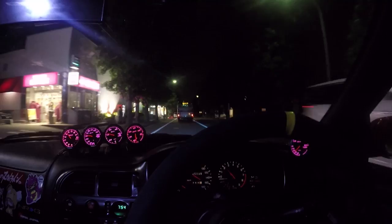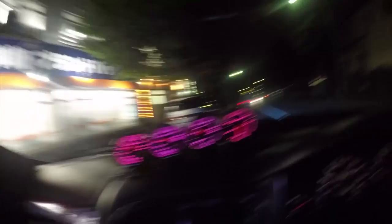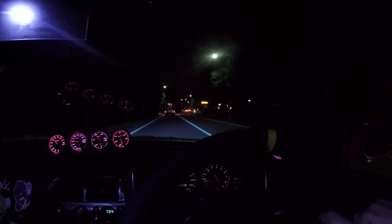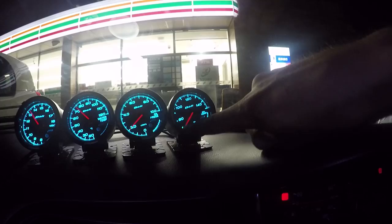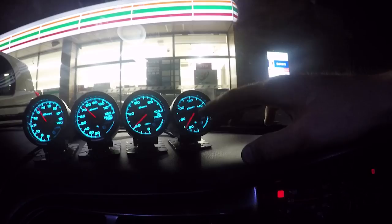Taking the car for a test drive - everything seems to be good. I'm waiting for the thermostat to open at 70 degrees. As the temperature gauge for the oil gets up to 70 degrees, the needle drops back down to about 65 pretty much immediately - it takes maybe 40 seconds to a minute before you see it starting to go down, then it creeps back up. So I can definitely tell that the thermostat is opening and closing.